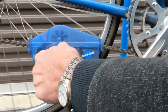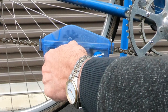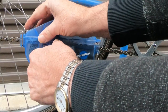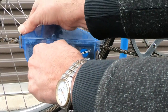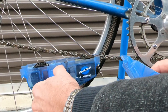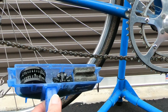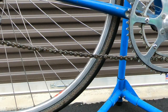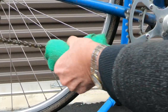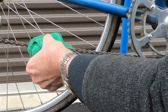Then you just pedal the bike backwards. Run through several revolutions. Now you just remove the top. I'm doing this outside and it is cold. I don't know if you can tell, but there is some grime in the bottom of that. Then you take a rag and do the same thing — pedal the bike backwards to dry the chain off as much as you can.